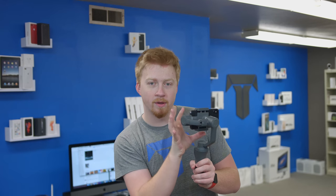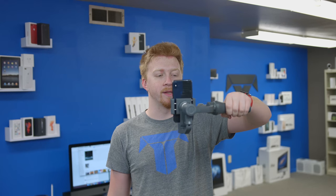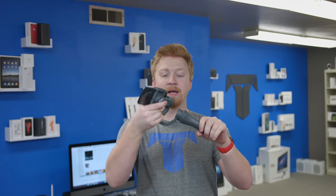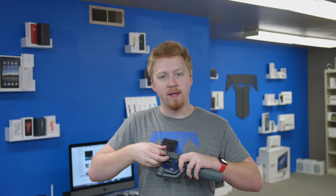There is now a portrait mode option as well. Don't do what everyone else did and try to force the gimbal into portrait mode — that's not how it works. There are two ways to go into portrait mode. You can tilt the handle and it'll autocorrect and start stabilizing in portrait, great for Instagram live streams or social media. Alternatively, the screw on the back holding your smartphone can be loosened — I recommend turning the gimbal off first — and then it will twist over. Lock it back down, turn the gimbal on, and it will stabilize in portrait mode because that middle piece is now vertical instead of horizontal. Now you can have extremely well-stabilized and well-focused FaceTime calls.